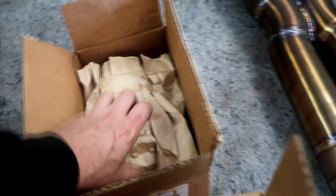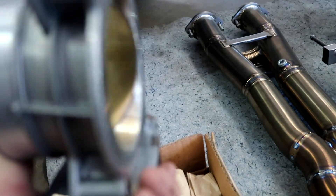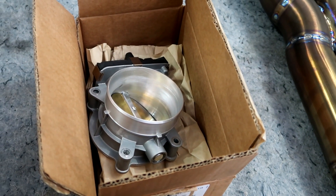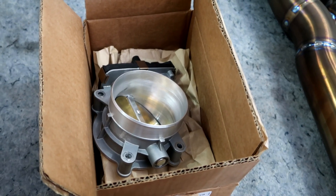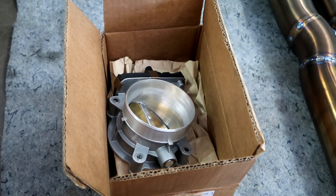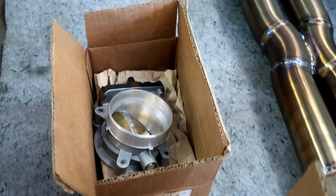I tested one and I think it picked up about eight horsepower, and it doesn't skew the air-fuel ratio like some aftermarket intakes do because of their larger diameter. This is a brand new GM throttle body that KTEC opened up and ported — this makes a huge difference with throttle response. It doesn't make as much power up top; we dynoed one and it made a lot of power down low, but the throttle response is night and day. On manual cars, right off idle if you take off with light throttle it almost has a stumble, which is probably in the programming.